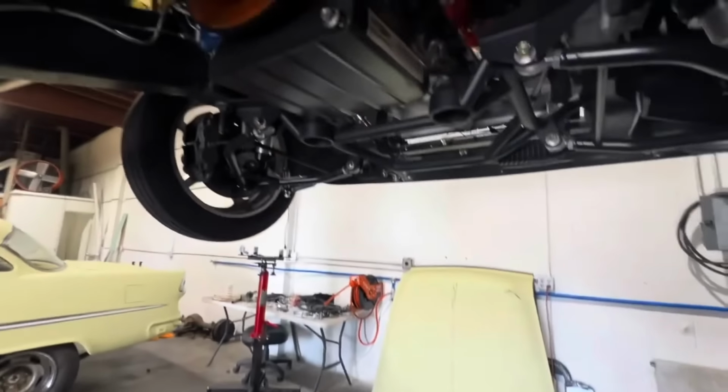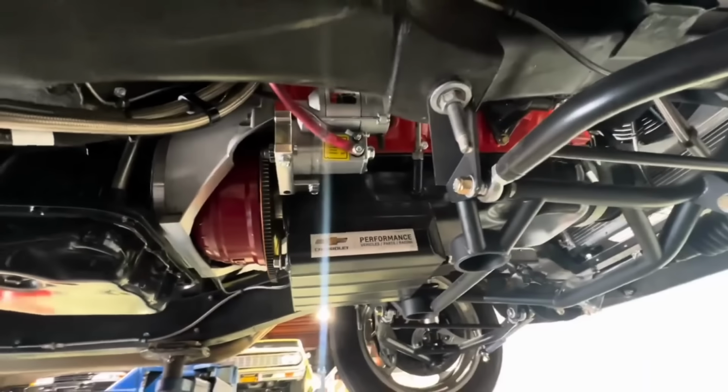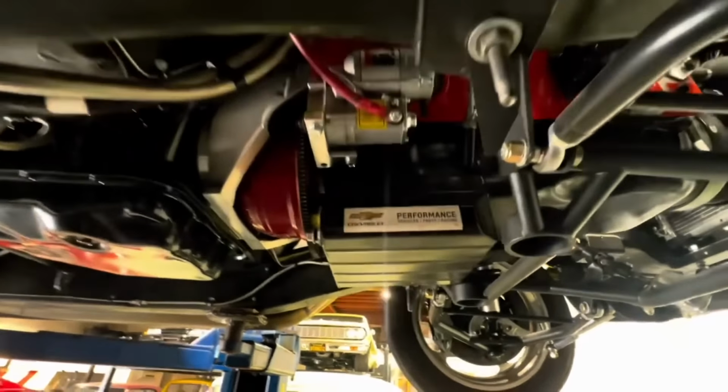Either way, I called John McGann. He had a Reactive Products flywheel in stock. There it is, right there, installed with a new gear reduction starter motor. It does not eat anywhere. You can see right there where it was just polishing the end just a little bit. It's not even a sharp edge though. It just took a little bit of the paint or anodizing off there. No big deal. I threw that one in. It starts like butter now.